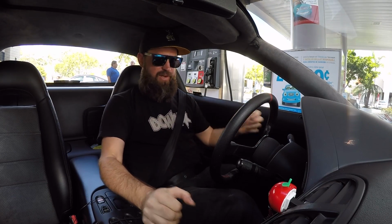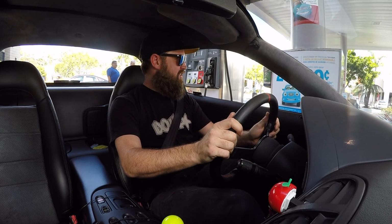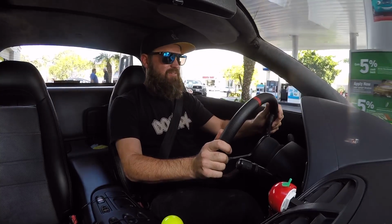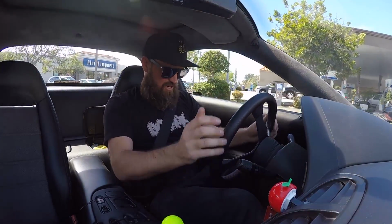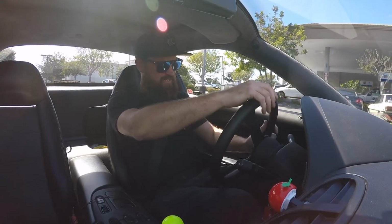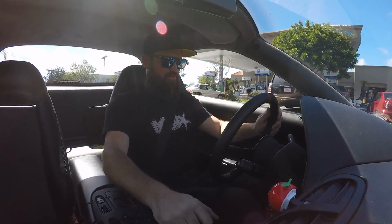All right, just got some petrol. Just tossed in 10 gallons with 10 ounces of Idemitsu premix. If you guys know anything about rotaries, premix is the way to go if you don't have an oil metering pump, which most people remove when they do a high performance build to keep from scavenging old dirty oil into the engine. So now we're, oh man, 10 gallons don't do much on this tank. Oh, the needle's just moving slow. Okay.